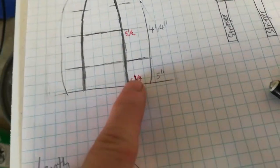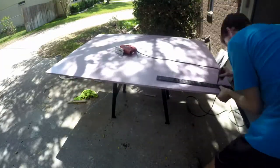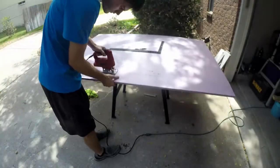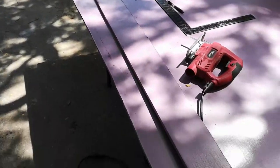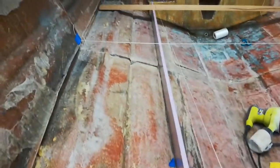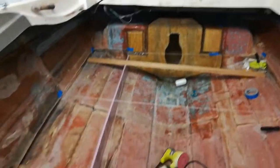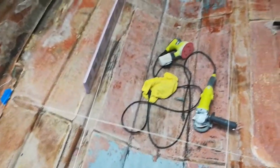I'm going to cut this one out of foam board first to see how it fits, and then it'll be easy to shave little pieces off to get it just right. Alright, there's a stringer template — time to go put it in and see how it fits. Just like that we've got our first stringer template in here lined up. It's fitting like a glove right in the groove where it needs to go. Got pretty good height at the back and at the front, so I'm going to go ahead and get all the other ones cut.